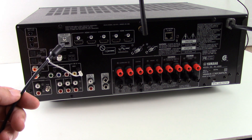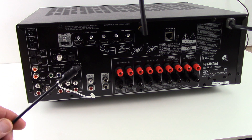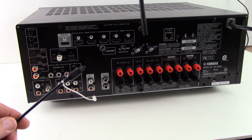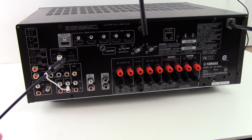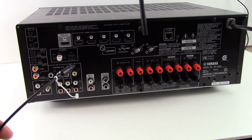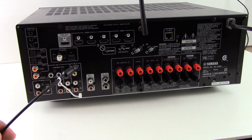The final step in this first example is to make the remaining connection with the opposite end of the Toslink cable connected to the converter box. There might be three different types of devices you'd want to hook up to. In this example, we're looking at the back of an AVR — a surround sound receiver — however, you might want to hook it up to a soundbar or some other type of home theater speaker system. What we're showing you is how to make the connections. We're not able to show you specifically why you would want to do this, because our example equipment all have sufficient ports to make connections without the converter. But so many questions come in about how to make these conversions, because a viewer will have one piece of equipment with one type of connector and another piece without that same connector.